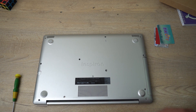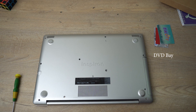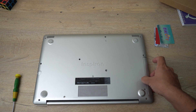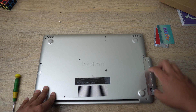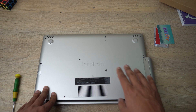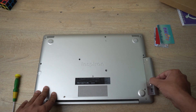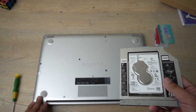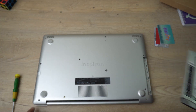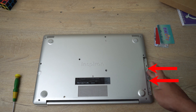Once you have removed all the screws, the first thing you need to do is eject the hard disk drive bay. Place your thumb here and gently pull it outward. Make sure you unplug this screw because it's the only one holding the hard drive or DVD ROM bay. Pull it out — here is my DVD ROM bay with my secondary hard drive. Place it somewhere safe, then unscrew the two additional screws as well.